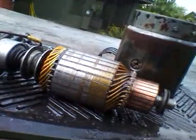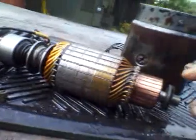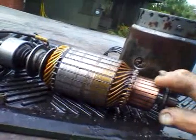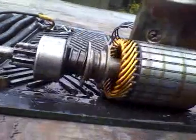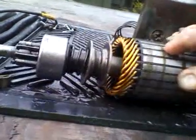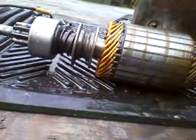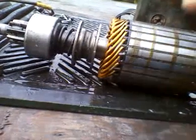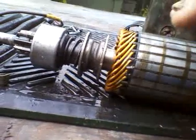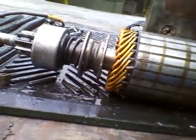When I moved into my house it had over 100 gallons of home heating fluid in a tank, so I've been using it in my shop to clean parts and stuff like that. I know it's like diesel fuel oil and it cleans really good, but it does leave an oil residue. So what I'm going to do is get some brake cleaner and spray it down to get the oil residue off.